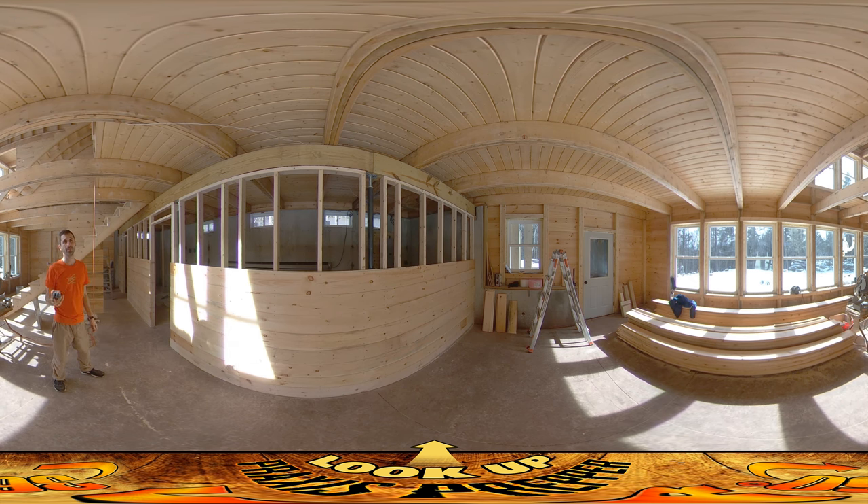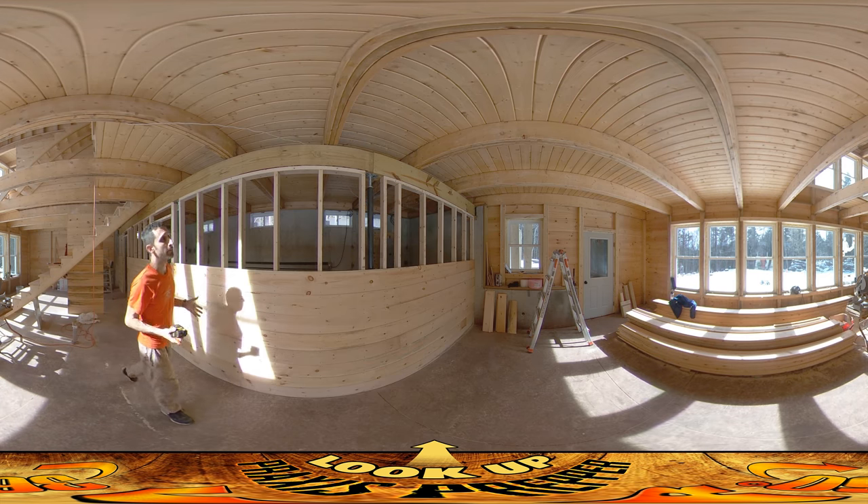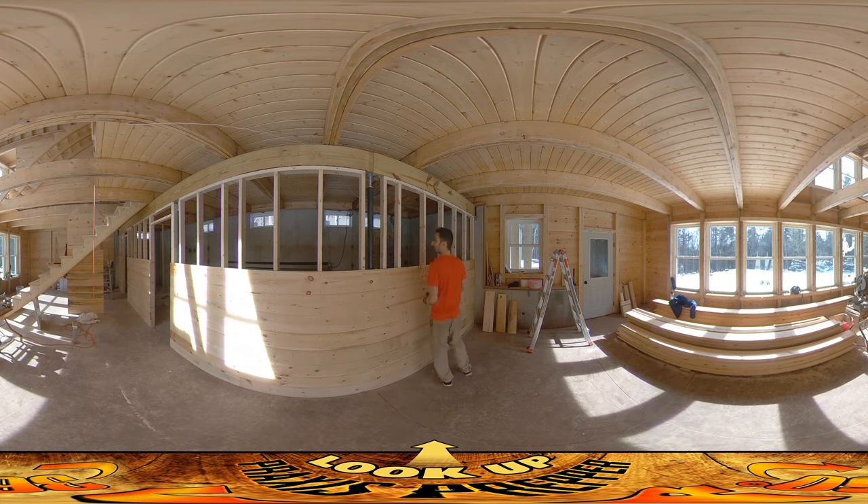But almost all the time you fall out of sync. The problem with falling out of sync is that you'll have one wall that's too high, one wall that's too low, and then you want a board that continues right across it. You end up having to trim the board and do all sorts of weird things and take extra time. It never looks quite as good, so it's great if you can just keep things in sync as you go.